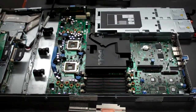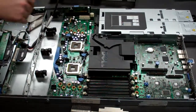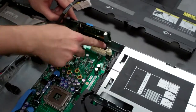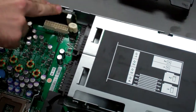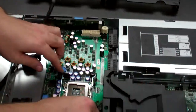The first thing I usually do is reinstall all the risers and the side plane. Take your side plane that you've already disconnected. You'll notice there's a little metal post that this lines up with — get that secured in and push down, and it should just push in without any tension when you're putting it on.